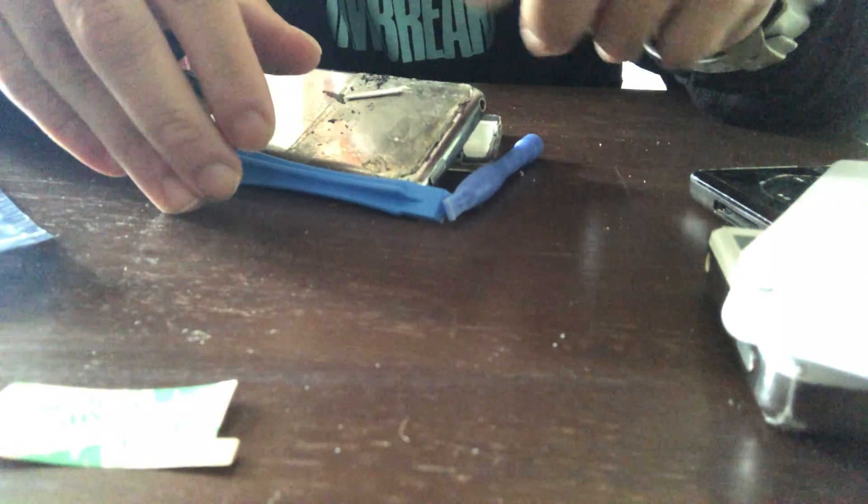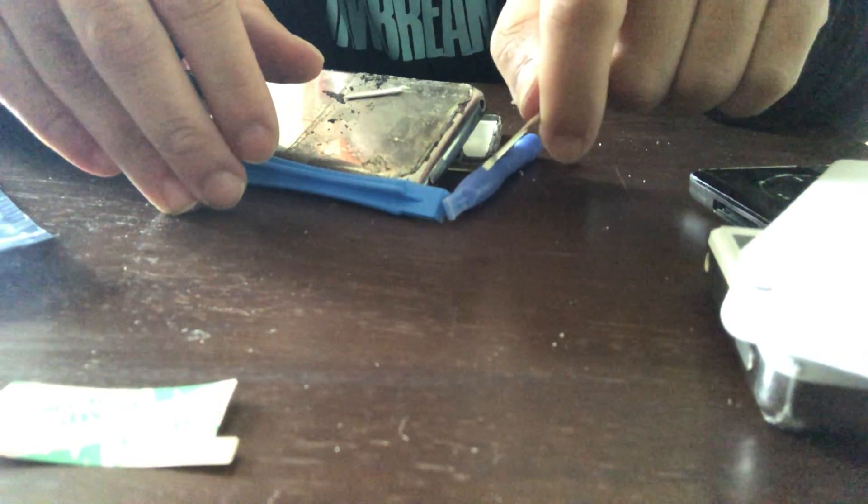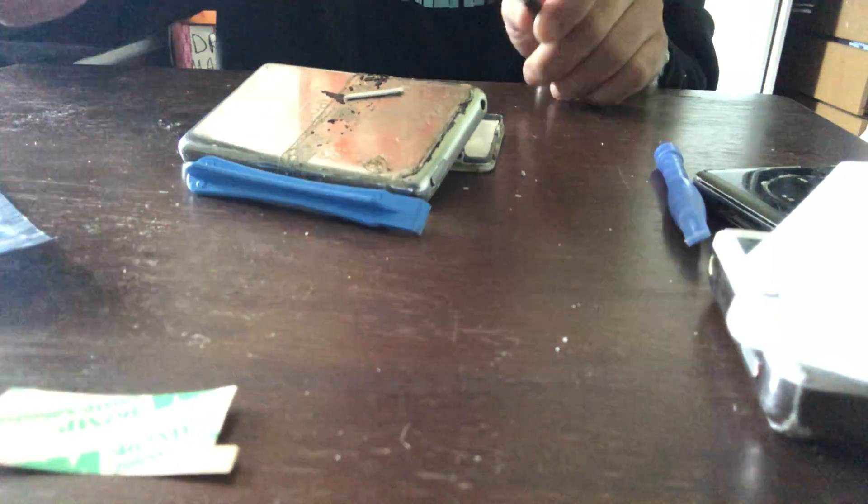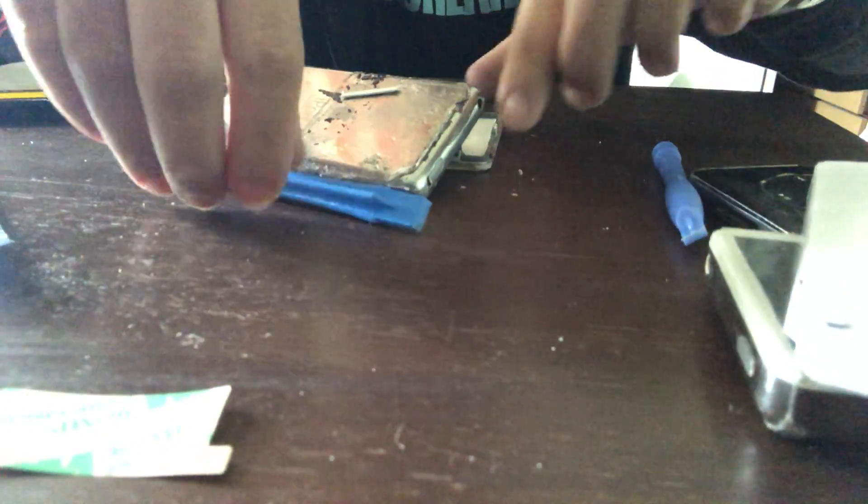You really don't use the flathead to screw anything — it's just there to lift open the security lock tab for where the iPod battery chip goes in and stays locked in, and then you can push it down with this, which makes it easier. This is how the battery looks — it's a small little thing, and this is the battery chip you attach it in, put down the safety latch to hold it together and it should work.